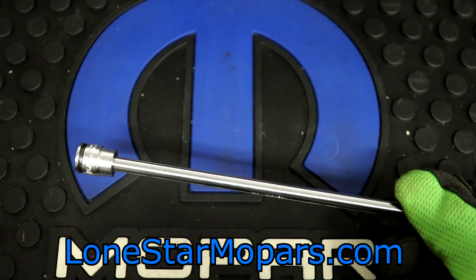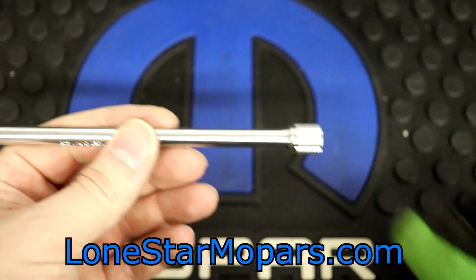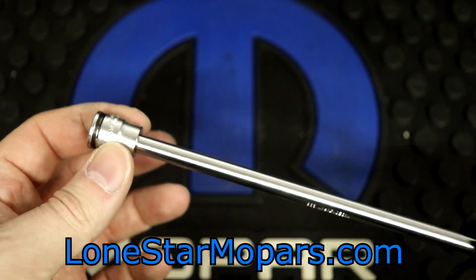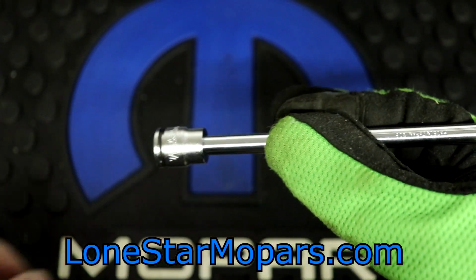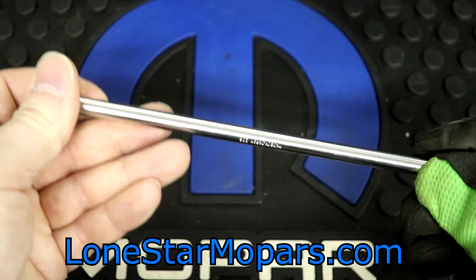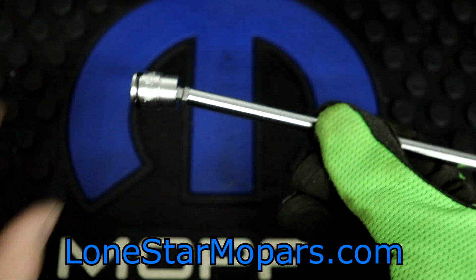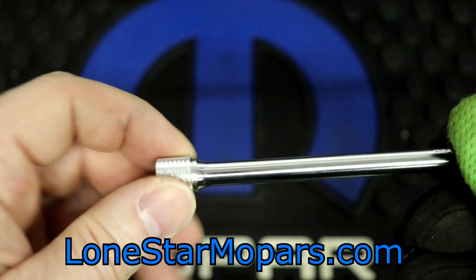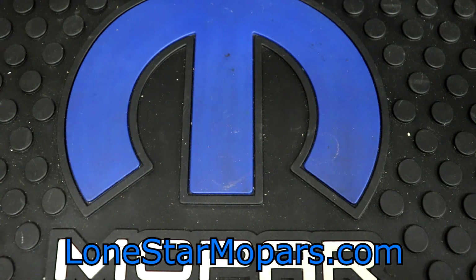Now, 3/8, that's sort of where we did like a 75, 125, 150. I use them all the time with no ratchet. And if you're like, no ratchet, what's the point of an extension? Well, if I have a shallow socket or a deep socket and tight confines, I come in and maybe I can touch it, but maybe I can't. So something like this would be excessively long in tight confines. I can't get the angle I need even with the wobble. But coming in with these extensions in the shorter versions, I'm able to sometimes grab, like the 75, get the wobble engaged, and then I can go to town. And the reason it's easier to go to town is that knurling right there. So it all adds up to just a fantastic piece, and it is why we spent $99 before the sale